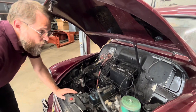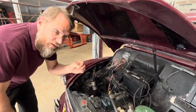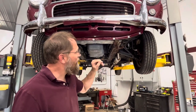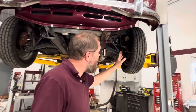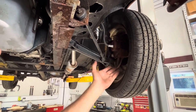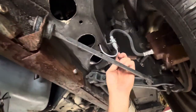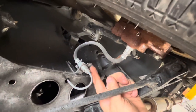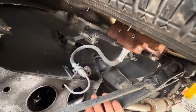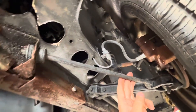We'll get this thing up in the air and take a look — his primary concern is how bad the rust actually is and what can be done about it. Now we got this thing up in the air. Before we actually start looking at the rust, we can see it has a disc brake conversion on it, which is a pretty easy conversion because you just take the disc brakes off of a later Midget. You can see here somebody couldn't figure out how to just cut these out of the brackets — all you'd have to do is use a nut splitter and take all that out really easy. So they just put a new bracket on here and zip-tied this in there. Not the way I would have done it, but I guess it works.